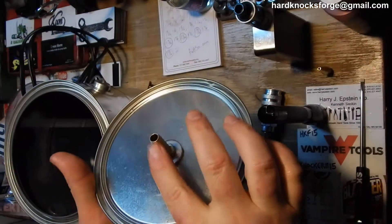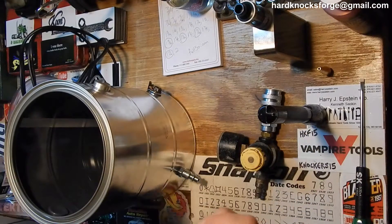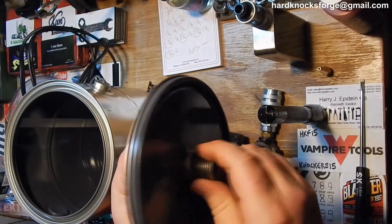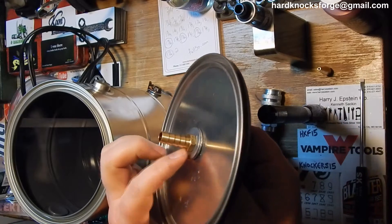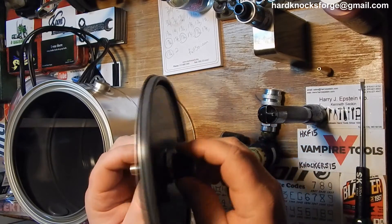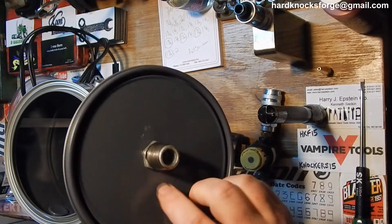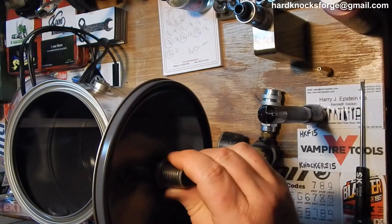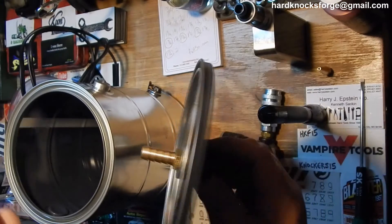On the lid here, what I have is another nipple that connects to the hose. And then I have this fitting right here which just fits on the outside of that. It's also pipe thread — this is all pipe thread. I put a washer up there to flatten it out. I was thinking if I did that I wouldn't have to RTV it, but I think I might have to go ahead and RTV it anyway. We'll see. That's all that is, is a nut.